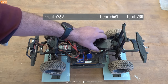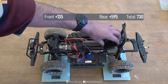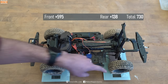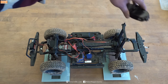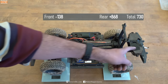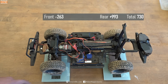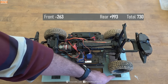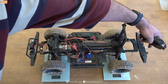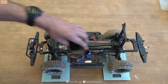If I put it in the center, depending on where exactly I place it — towards the back we've got 595 and 135, put it towards the front and it's pretty much reversed, with more weight on the front axle and still some on the back. The same effect happens on the rear axle: placing weight behind the rear axle gives 868 grams there even though it only weighs 730 grams, with minus 138 on the front. Put it all the way at the back and it's minus 263 at the front and plus 993 at the rear. Remember that's only 730 grams — that's the equivalent of tow ball mass being pushed down there.